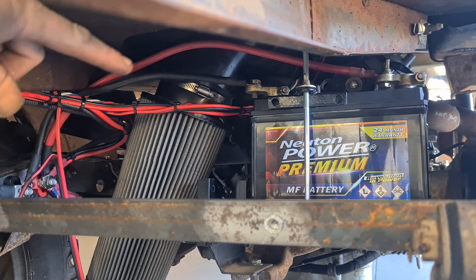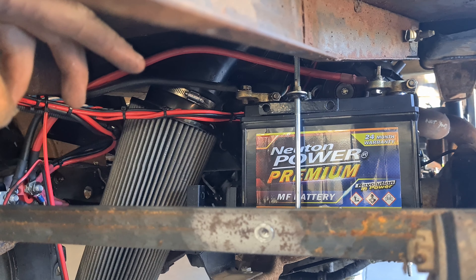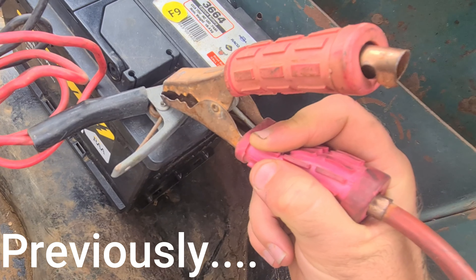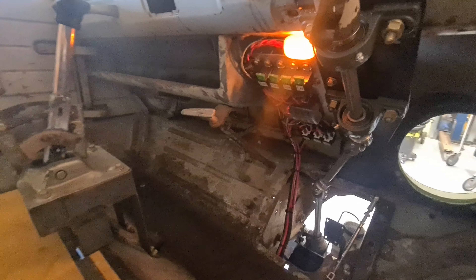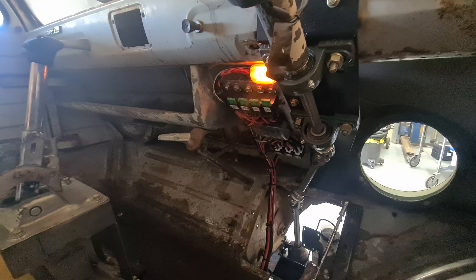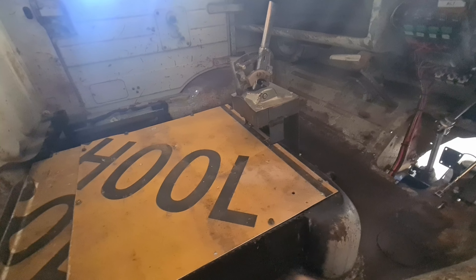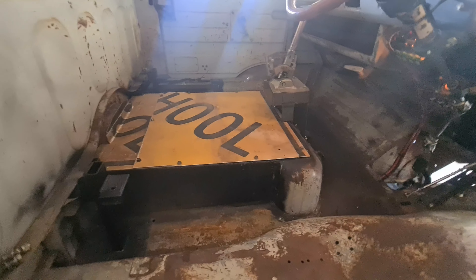I finally bit the bullet and bought a battery. I've also done the two cables up the top which go to the bulkheads. I just want to make sure this battery works — I think my jumper leads are dead because this battery is brand new and still wouldn't jumpstart this thing, so all those other batteries are probably fine and it's just the cables that are badly damaged. With that brand new battery installed, we should be able to test the alternator light. It comes on with the isolator, fuel pump and everything comes on as it should. It's running — the alternator light has gone out. Engine cover's on and done. Alternator wiring works, starter motor wiring works. And it turns off, which is rather important.